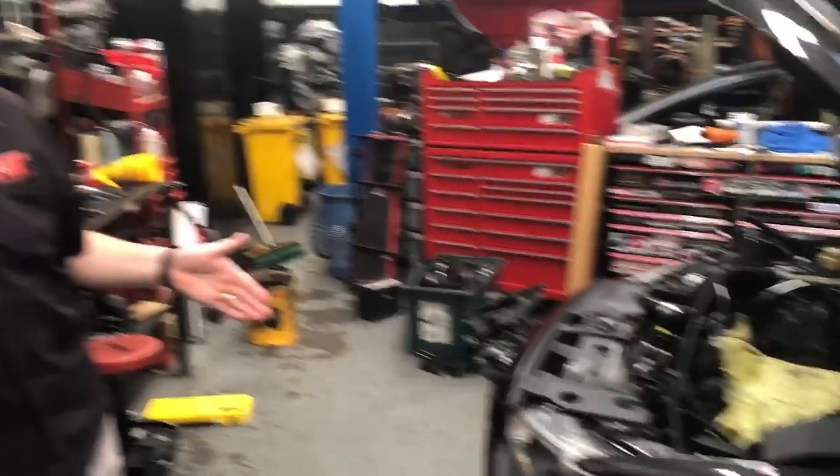Part of the diagnosis at the time of purchase, we found some mechanical problems with the car, and the client has chosen to leave the car with us to do some more inspections. Part of that was to pull the head off, because we did a compression and a leak down test and it wasn't probably as good as what we'd expected for an engine that had such a major performance upgrade with a recent engine rebuild by the previous owners.